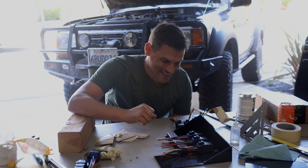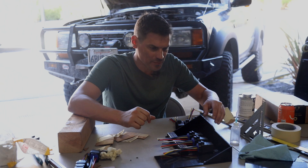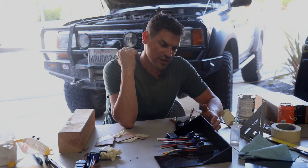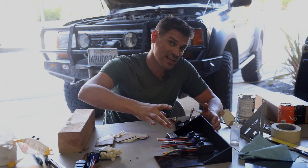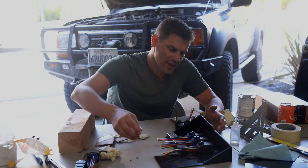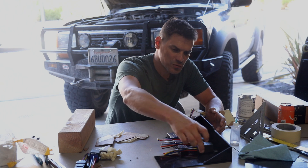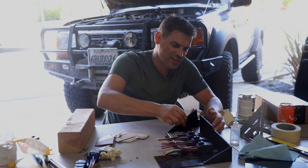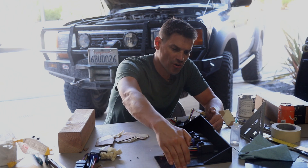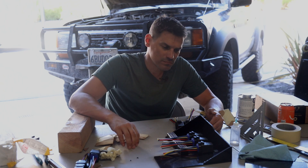I got a haircut. While I've been mocking this up, going back and forth between the rig with cardboard and starting to put together the pieces, I've changed my plan a little bit. I was going to make this an enclosed box, but because of the limited room under the hood and because I want it to be accessible if I need to replace anything without having to pretzel my fingers, I think having it open is actually a better solution. I'll have the relays lined up in back — six of them — wire blocks here, and the Blue Sea fuse block right here, reinforced with 90-degree angles and mounted very securely. It'll be open, accessible, and still very clean.